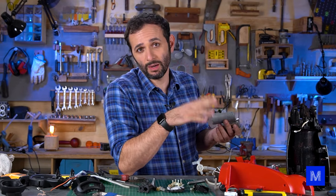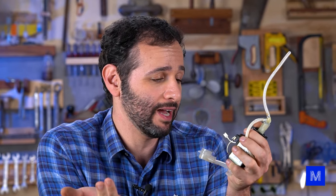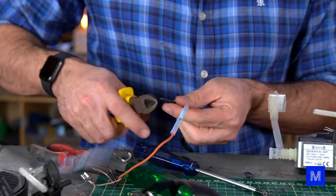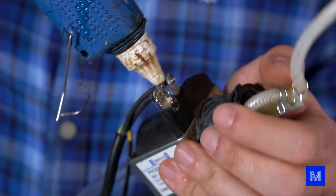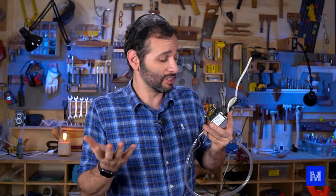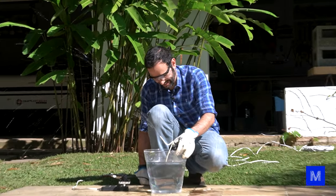We've arrived at the water pump. There are only two terminals here, so not much room for making a mistake. As it's 220V, there's no safe place to touch it, so I have to be very careful not to get the pump wet at all. I'll use the coffee maker's own wire and put a longer hose at the entry point, insulating it with hot glue. It's not the kind of insulation you'd rely on for life — just for us to test the pump. One, two, three — it doesn't have the same power without being in the machine, but it works.